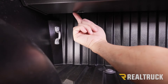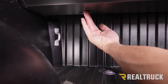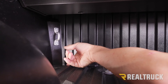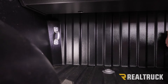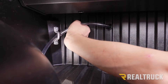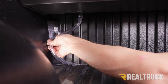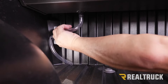Now we need to install our drain tube. We've got a hole on the bottom of our canister — peel away the plastic protector before you install the drain tube. We also want to figure out where we want to route it. There's a small weep hole in the bottom of our bed for water to go out — you can either just widen that out, or I'm going to run the drain tube straight to that. I'll run the drain tube through my tie-down point, plug it into the bottom of the canister, and bend it around to terminate right above where that weep hole is. Repeat the same process on the opposite side.